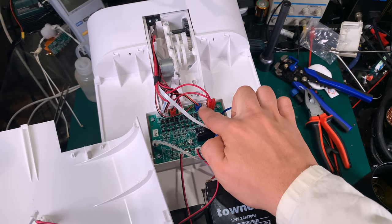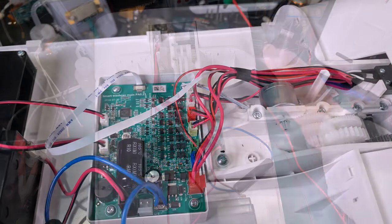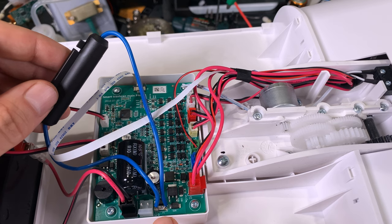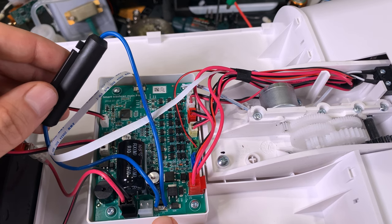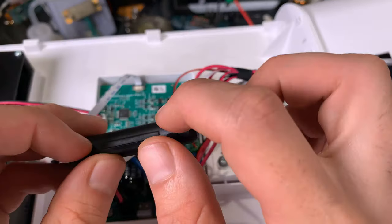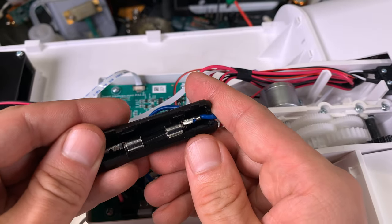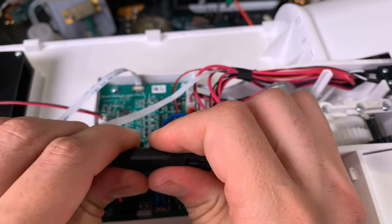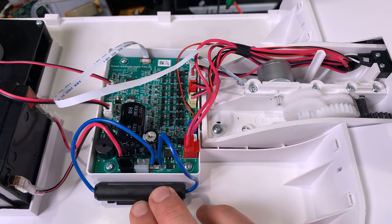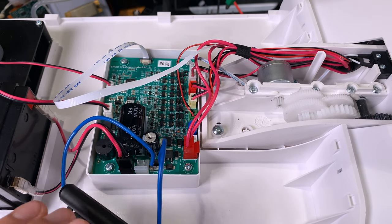Which is located here. Let me show you what happened — here is a close-up. This is the fuse, 6.3 amp in SMD form factor. I did not have exactly the same, so I just soldered two wires and used this inline fuse holder — a holder for a glass fuse. There is absolutely a lot of room to glue it, for example here, so it's not going to rattle. You just need a fast-acting fuse with some sort of holder.